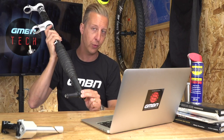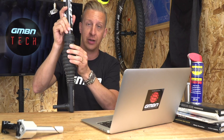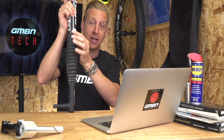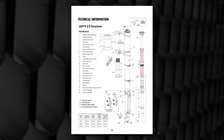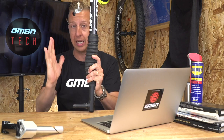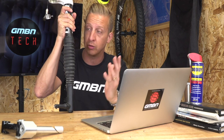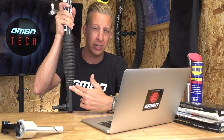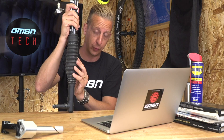There are a few reasons this works. The major one is that the telescopic stanchion leg inside is actually square, and it's got bearings on four sides — 88 needle bearings inside. This gives the fork incredibly supple action and resists the twisting you'd expect from a single-leg design. It's got a single axle at the bottom and the wheel literally bolts straight onto that axle, just like a car wheel. People look at these forks and think they can't possibly be stiff, but they're incredibly stiff. Due to that square stanchion, they resist binding under braking — some lightweight telescopic forks can twist slightly under braking bumps, causing binding and preventing plush travel. The Lefty doesn't have that problem.